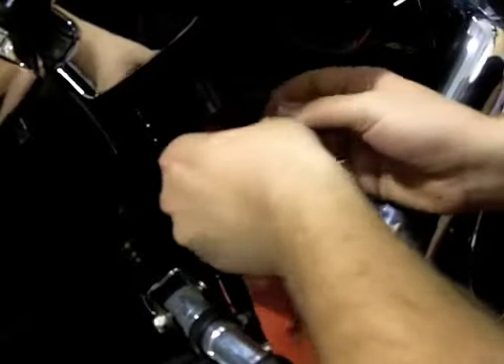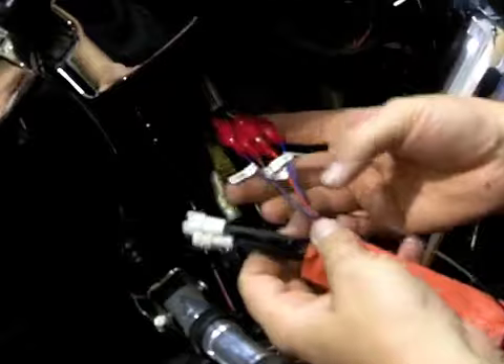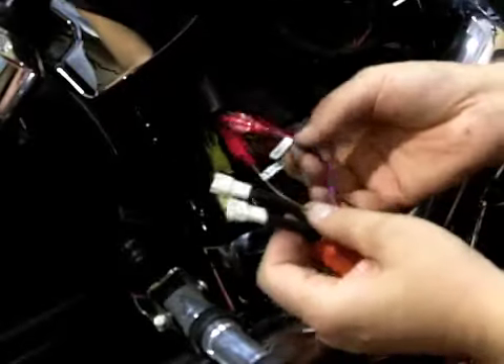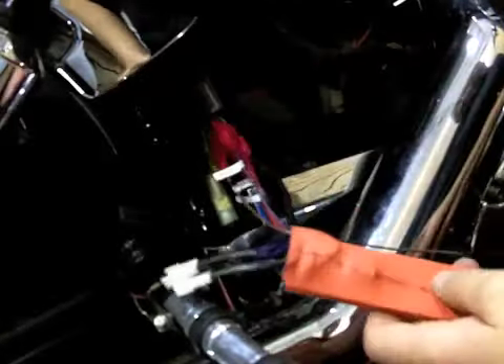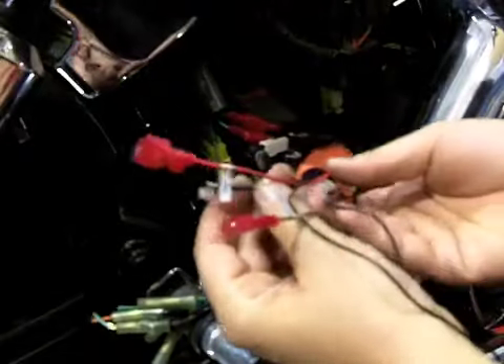While pushing each of these in, you're going to hear a snap sound, and that's perfect. So now we have this side of the run turn brake controller connected. Now we need to go to the wires that come from the back of the motorcycle, put their connectors on, and plug them into the output portion of this run turn controller.